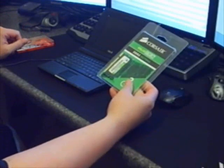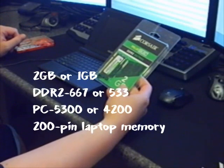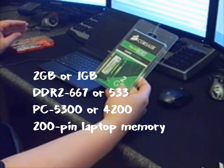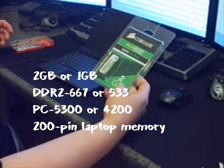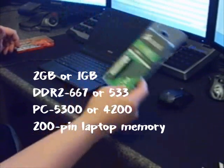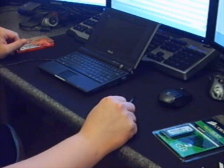Of course, you'll need to buy laptop memory. This is standard laptop memory — DDR2 667 MHz. DDR2 533 will work equally well in here, but I just bought a Corsair Value Select that should work just fine, about CAS 5 latency, which is more than enough for an EPC — so your CAS latency isn't going to matter too much.